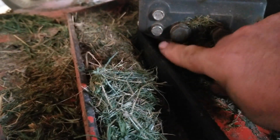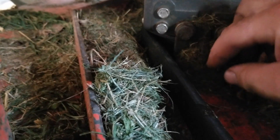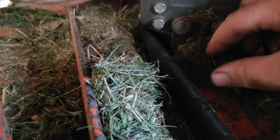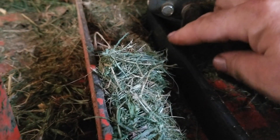So here's the drain. You don't have much clearance at all between it and the deck, so you've got to get a tiny little pan to fit in there, or it ends up just running all over the deck anyway. It wants to drip out directly onto the belt, and gear lube is not good for belts.